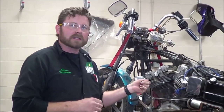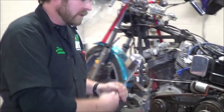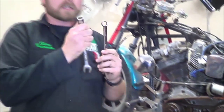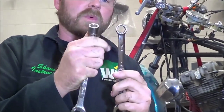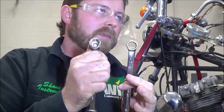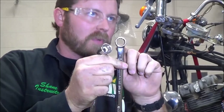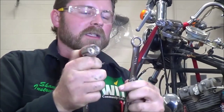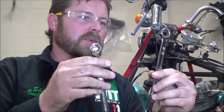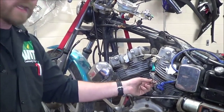The other thing I want you to focus on is fasteners — we talk about 12-point versus 6-point. Most of the fasteners we deal with are a 6-point fastener. Harley does use a lot of 12s on brakes and things like that. So it's pretty common to take a 12-point and go upside down trying to take this off.